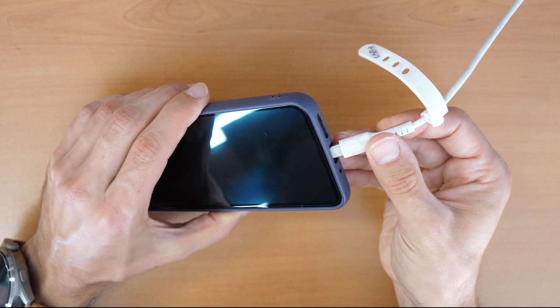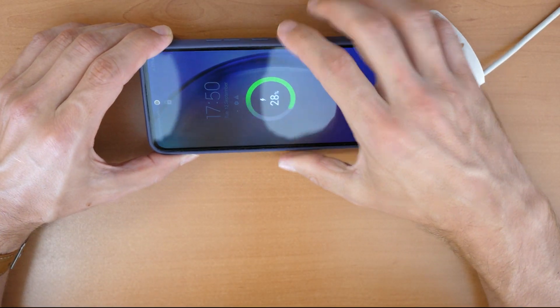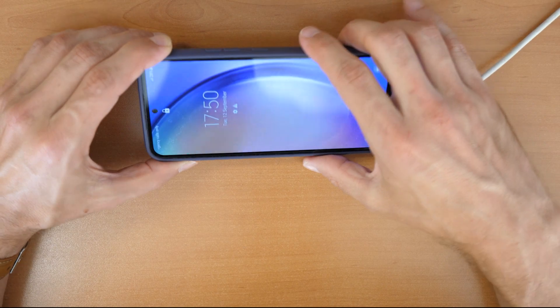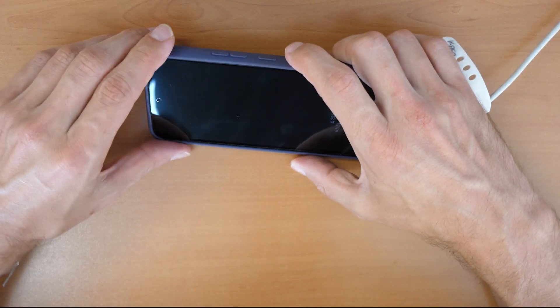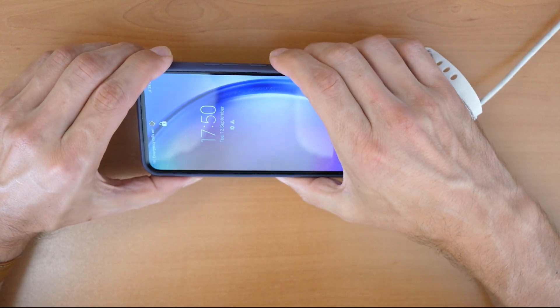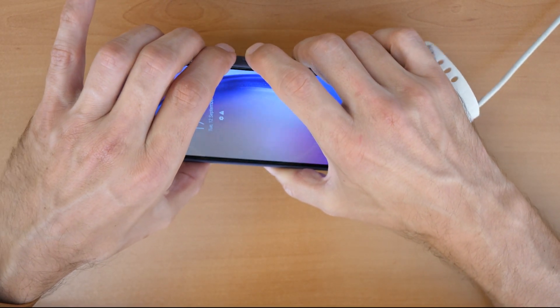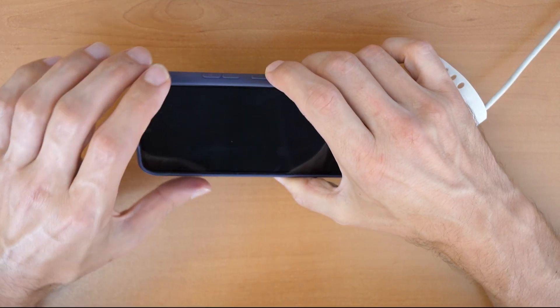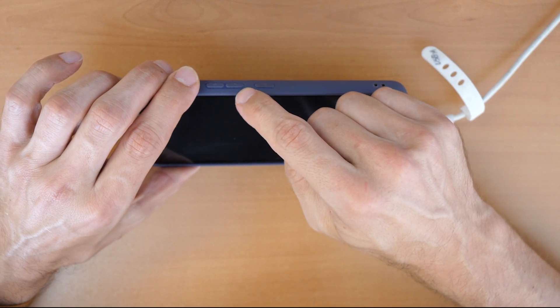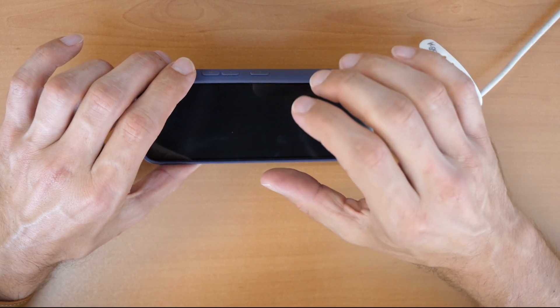So let's try. You plug in the cable, and then because the phone is powered on, you will need to press all three buttons until the phone restarts. You need to click all three buttons at the same time until the phone restarts. When the phone restarts, release the volume down button but keep holding volume up and the power button.